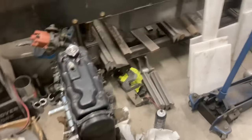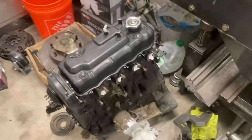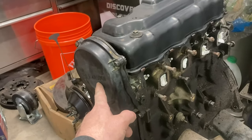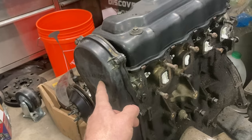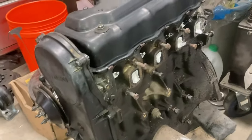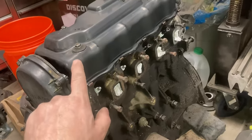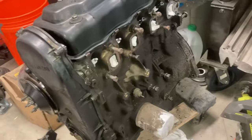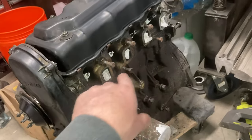I've been slowly cleaning it up — it's a total greasy mess. I put a new seal in behind the cam sprocket; that seal was blown and the whole thing was full of oil inside. It looks like the valve cover gasket was pretty weepy too, so I'm going to get this all scrubbed down and cleaned up.